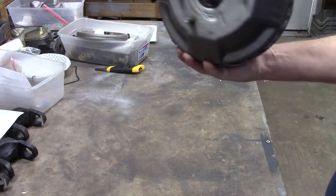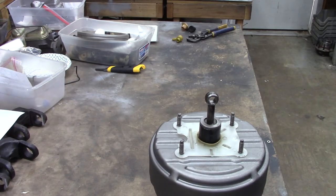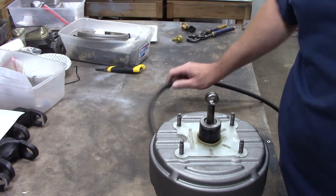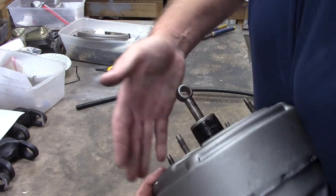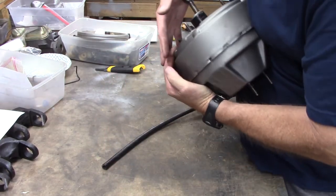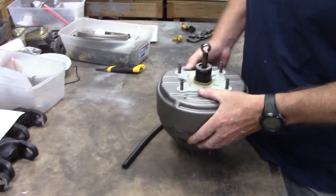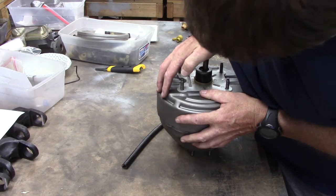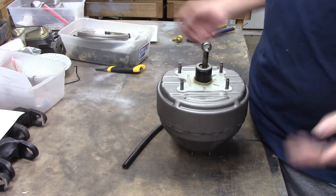Let's just check it out — we're doing a field test. We can tell a whole lot of things from a field test. Number one, you'll find on a tandem bendix booster, because of the return spring and all the guts in there, that you just about cannot — it is nearly impossible for you to depress the rear hub and actuate it with no vacuum. See how hard that is?